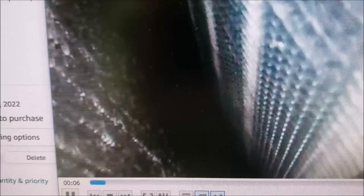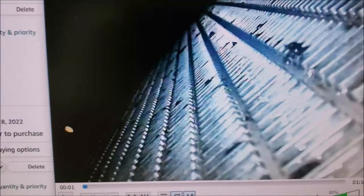It was just about completely plugged — solid black. Get close to it so you can see it clearly. That's the before. Now I'll show you the after, because you can take that scope all the way down toward the bottom of the radiator core. It was just completely plugged up, but externally it looked perfectly fine. Here's the after — after we did the cleaning process, just a few little speckles left. We went over it about three different times.